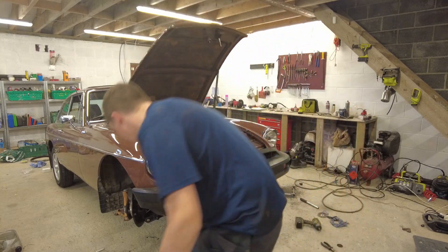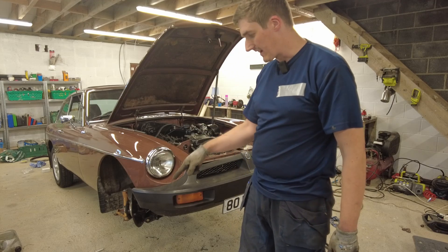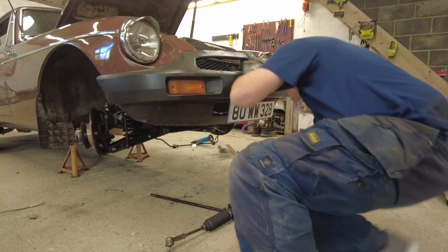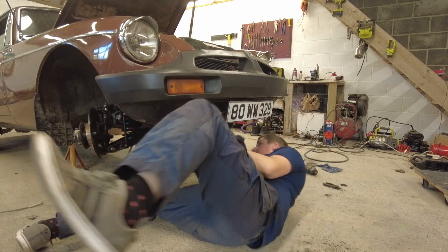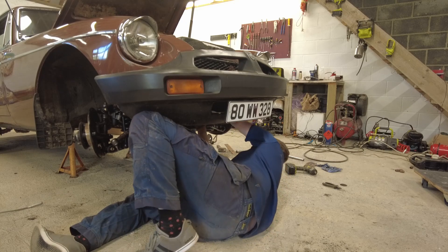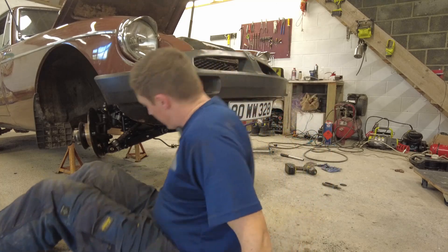So the next bit as I said - steering rack. What I'm going to do is slide it in and put the steering shaft into the UJ first, then get my track rod ends on. I might just drop the track rod ends in loosely just to stop it from falling out, and then we'll button everything up. The steering shaft actually goes through the engine mount. Alright so that's on there. As I said we'll drop our track rod ends in now anyway - and then I cannot believe how bad the covers have gone on them.